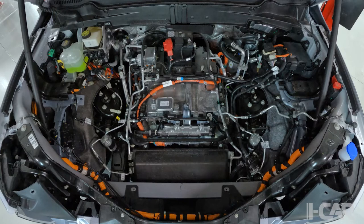Yes. So I will note the actuators that are on each side that open and close the hood. They're rather long and very similar to a vehicle with an electric opening rear gate or hatch. Down each side of those fenders, what looks like weather strips are the pinch strips. So they're the anti-pinch strips. They're actually sensors that, if somebody has their arm in there, whenever that starts coming down or there's something in there blocking the way, are designed to warn that system, and it'll stop the closure operation, back it up and open it back up.